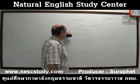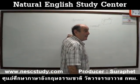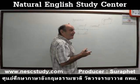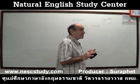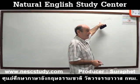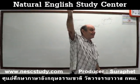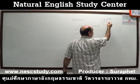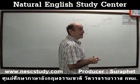But the reason for alternators was the car and the bus. The bus was the number one problem. With a dynamo, at slow speed, the dynamo does not produce maximum electricity to charge the battery. If you've got all the lights on inside the bus and the radio playing, it drains the battery. The battery does not have enough electricity to keep the electrics working.